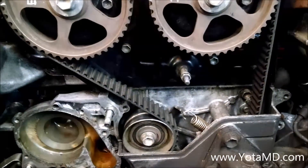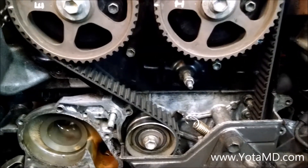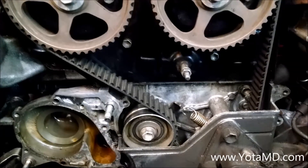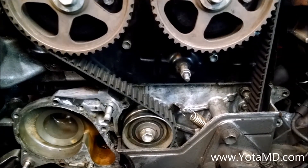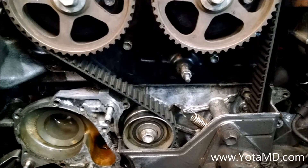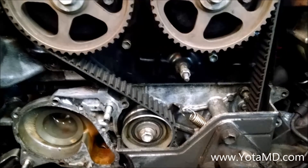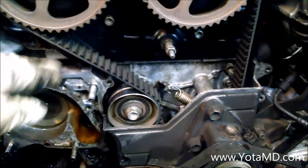If you do not seal that, it is a huge pain in the ass. You can't really seal that with the head gasket installed. So if you miss that step in a rebuild, you've got to essentially tear everything apart again. FYI, that's why it's important to do that — I just figured that might be helpful to see.